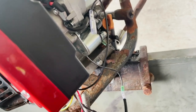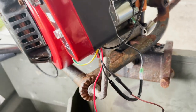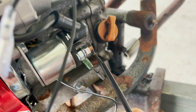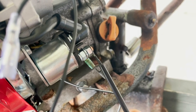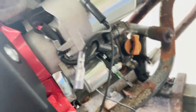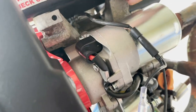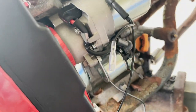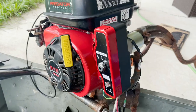From there you just need the wire cables that connect to the battery and it should start up. The red wire and positive wire will plug in right there, and the black ground wire I'll probably need to find a bolt to attach it to up here. Then we hook the battery up and see if it starts. That'll be the last thing I have to do. Hopefully it'll start — I have a bad feeling something's going to go wrong, but there's only one way to find out.